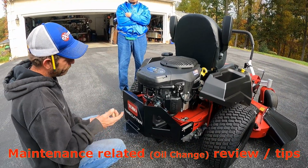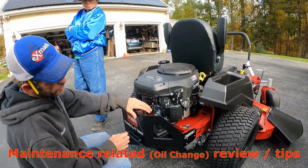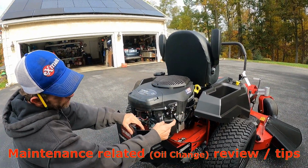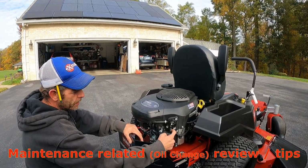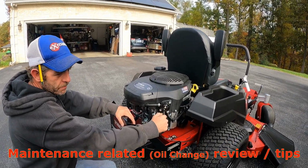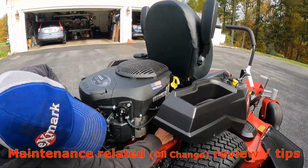Is that a fuel pump, I guess? Yes, sir. Okay. So just make sure you're not raking against this. Over time, sometimes these things dry rot and break, and it doesn't want to pull fuel, and they split at the seams. Sometimes you can't see them, so just kind of check it every once in a while. It's just the one on there, right? Yeah. Your fuel filter is right there.